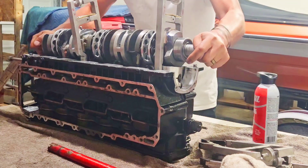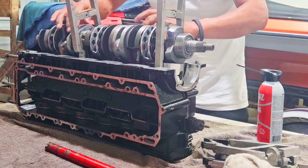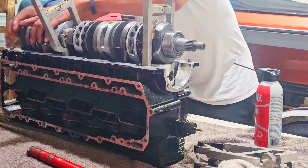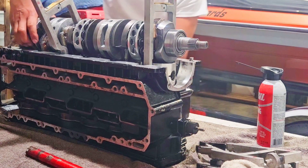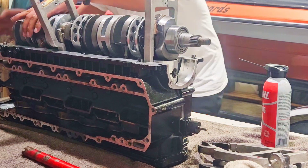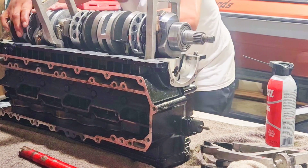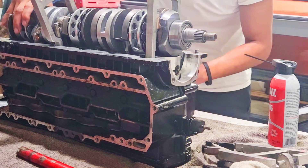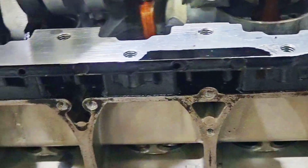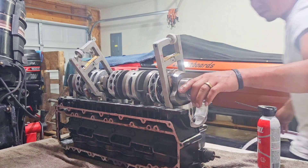Number four looks like it might give me a little bit of a problem. The pin's facing up — there's the pin facing down. I have a reed valve stuck. I should have had everything facing down to prevent this from happening, but I was irresponsible. See how this cage is just a little bit off — that means I'm about to pull everything back up and redo the whole thing over again. I pulled it off just to rotate that assembly.